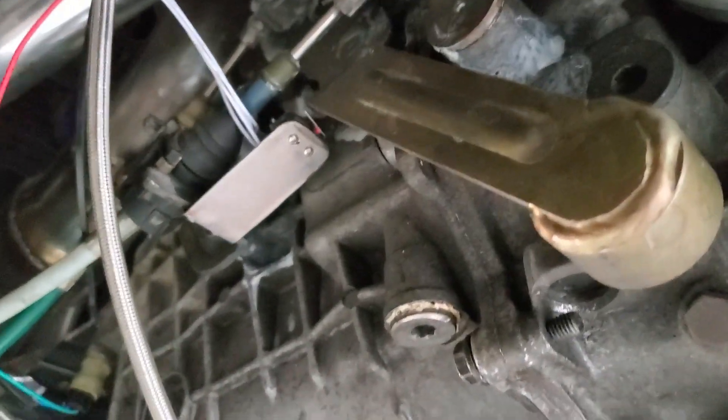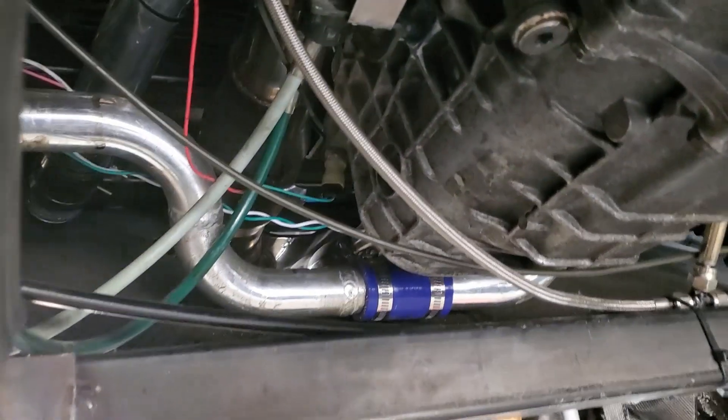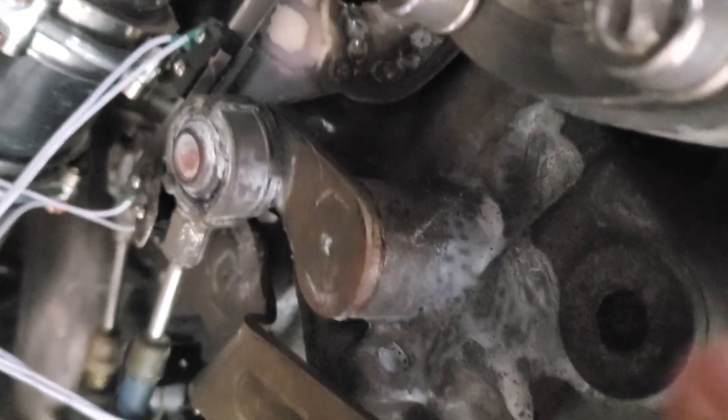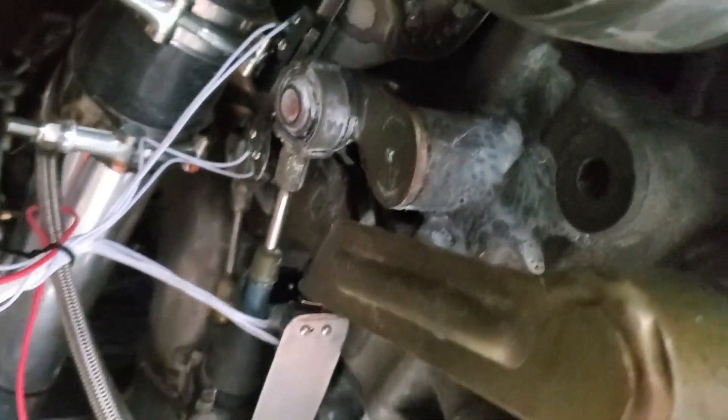As you guys remember, we did have some issues with the shifter. I thought mostly it was because of heat soaking into these lines, making the plastic a little sticky and causing it to not be able to go into gear. What I found was there's this intake pipe right here, and it was sort of interfering with the gear shift. I'm wondering if as things warmed up, it kind of settled onto the shifter and made it difficult to shift. I went ahead and moved that pipe and put it into another position.